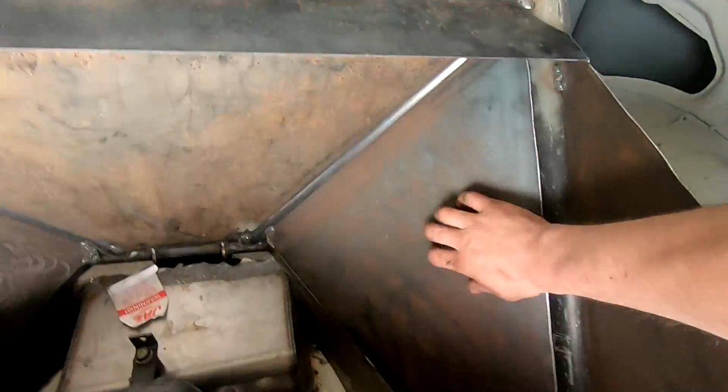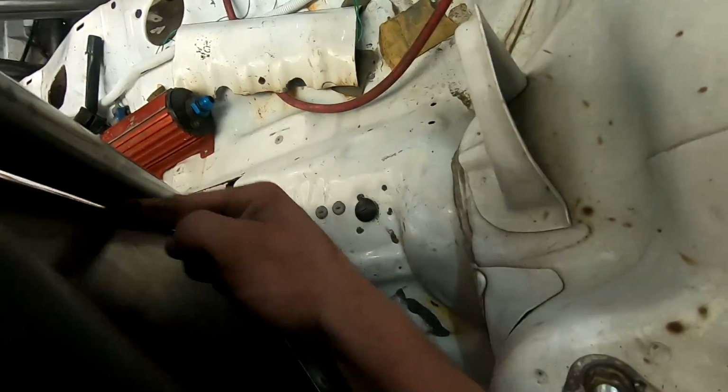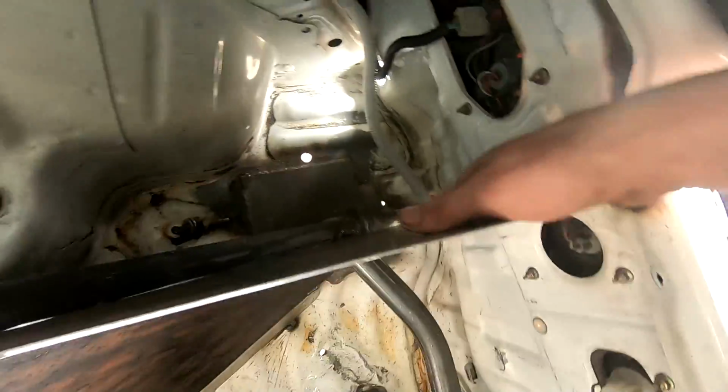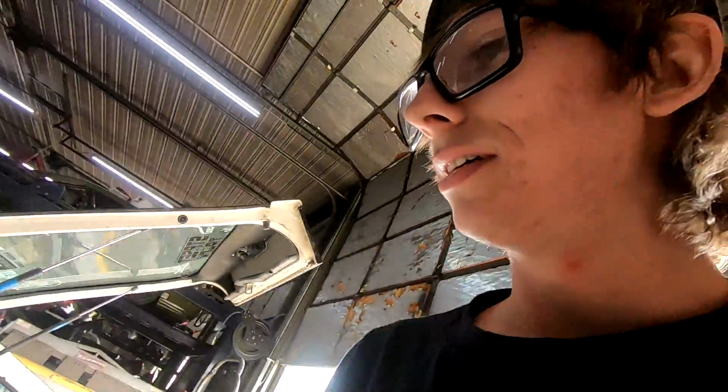You know, Jordan is a huge help around here. He kicked butt yesterday. He did all of this stuff, fit all this up. And now my job is just to, I think I'm gonna run along on the outside actually, and just run a seam sealer in here, seam seal these outer edges so it still looks pretty clean in here. Might not be able to get back in here, but I might be able to. See if they make mini caulk guns, mini seam sealers. Get one of them mini ones in there, or even if they do like Honda Bond comes in a little toothpaste tube. If they do seam seal like that, I could get some seam seal real clean with one of those, dude. Tell you what, I'm pretty good with one of those. Whew.